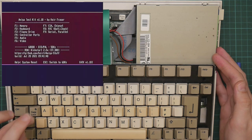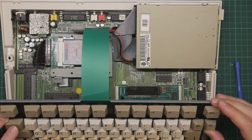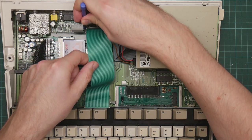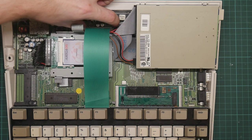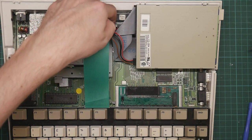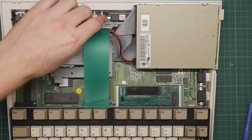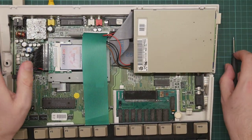That's not good. Caps lock light is not lighting either. Now, what is wrong? Let's try reseating this. I need to lift the clamp, which is tricky. Yes, because the new connector is thicker, the new cable is thicker than the old one, the clamp has locked in place rather. This is going to need more work than I can really do on camera. Be back in a moment.